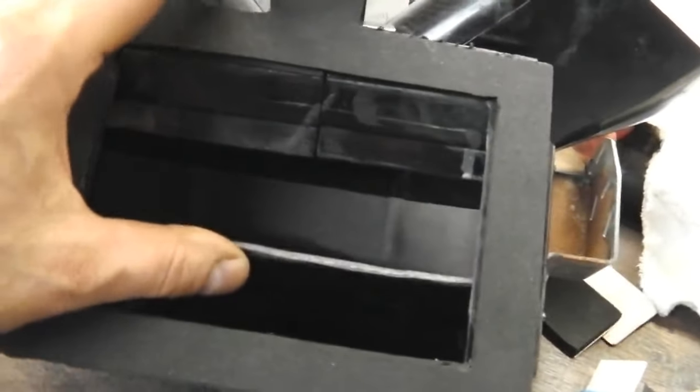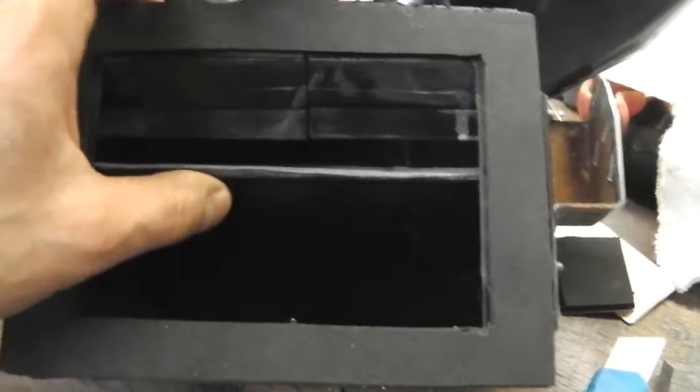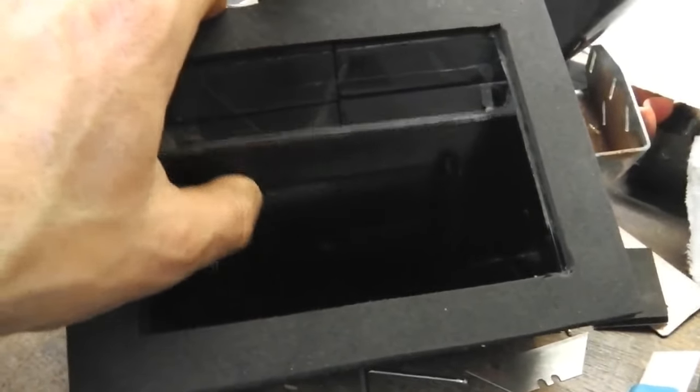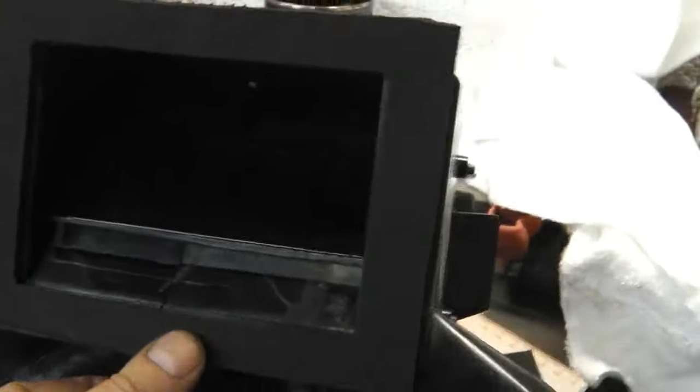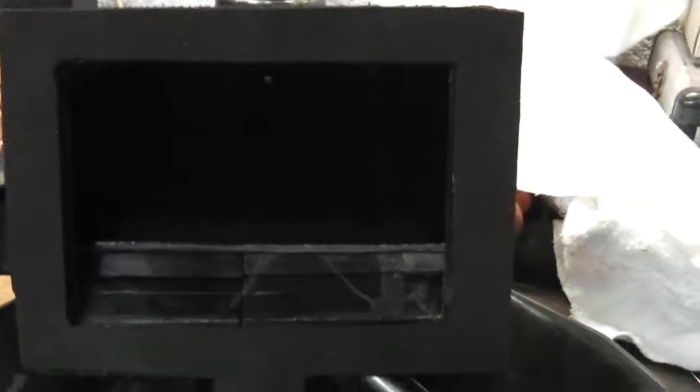First flap is, funnily enough, your cold air vent flap. When you turn off the fan, that's the electrical fan switch on your dial, not the heat control, the speed control for the fan is actually also linked to this flap. So when I shut off the fan, it completely closes that flap, which stops any air at all coming to the face or your feet. So turning off your fan on the symbol down to zero closes this flap completely, which makes all the air go to the air vents, so no air can get down that way. So the full pressure of air is coming up to the fresh air vents, and when you pull on the fan lever towards you, it then puts the fan motor on full speed, leaving this shut, leaving all the force of the fan to force it out the air vents.